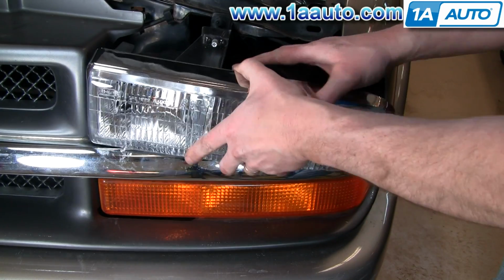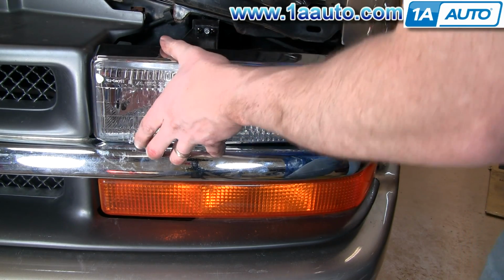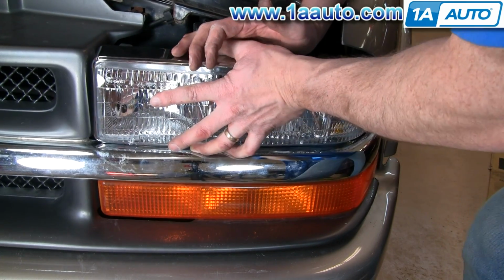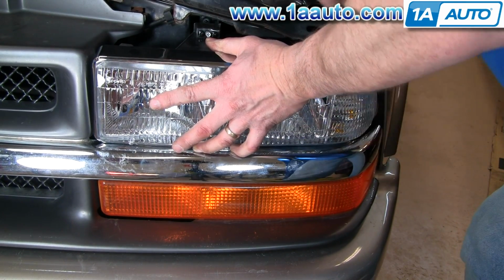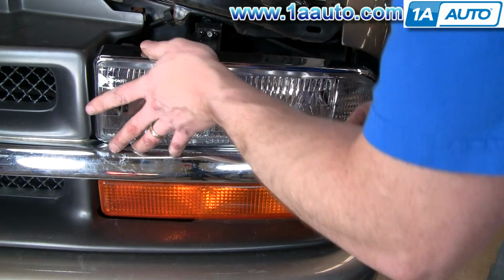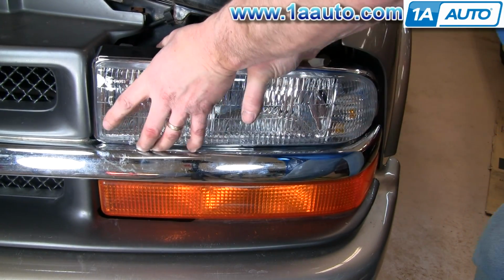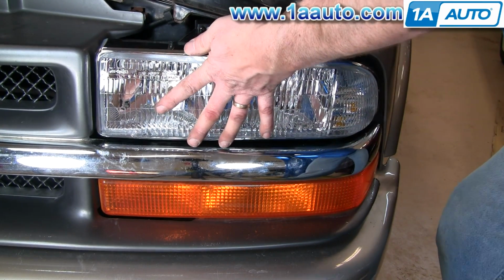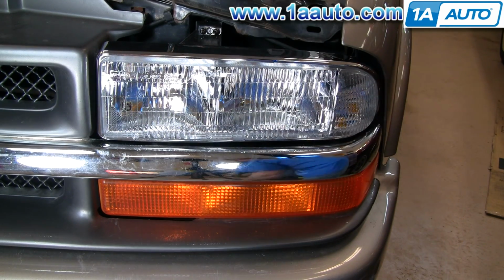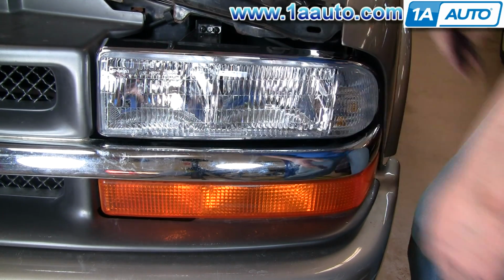of the headlight. Okay, and then you put your headlight back in there, and this is a little ballet of kind of pushing on the backside of the headlight, pushing in and down at the same time, and then getting everything to line up. And you can see down, there's a couple of holes that you can see down into to see how things are lined up. And then once you get it, it goes in, and then you put your locking tabs, which I didn't do a very good job of videoing there, I apologize. You put your locking tabs back on, and you're all set.